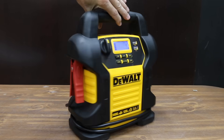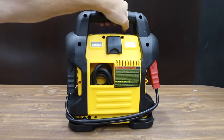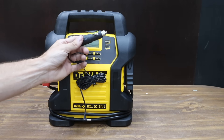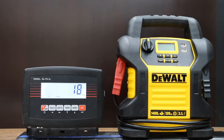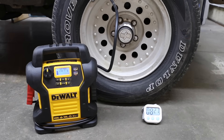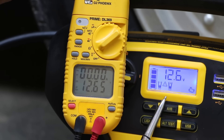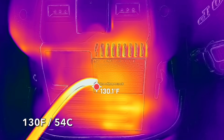At a price of $149 is the DeWalt brand: 1400 peak amp jump starter and 120 psi air compressor. The DeWalt is the only brand that does not have a power inverter. It has two USB ports and includes an option to test your alternator. Made in Vietnam, it is the second heaviest at 18 pounds and the quietest yet at only 80 decibels. The compressor shut off after about 10 minutes and 13 seconds, reaching around 29 psi. There's still plenty of charge left at 12.65 volts and the hottest part of the case is 130 degrees Fahrenheit.